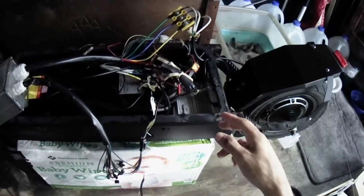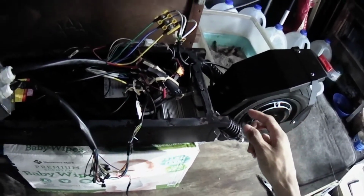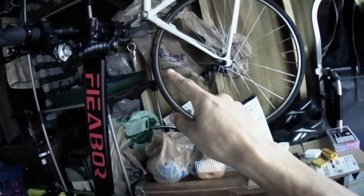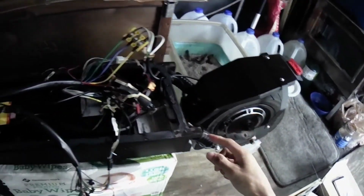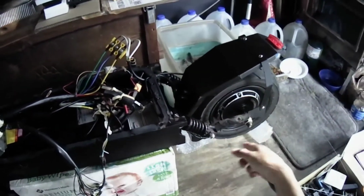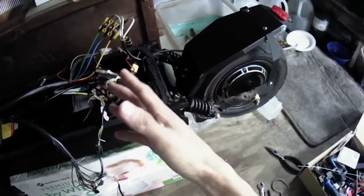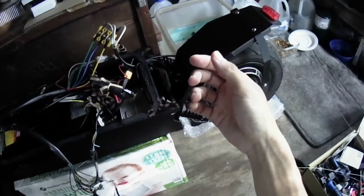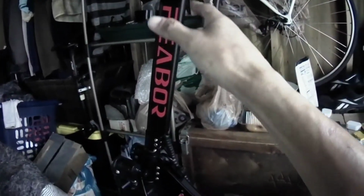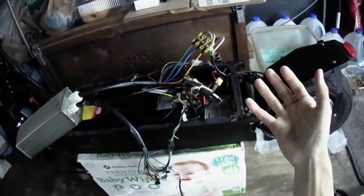They did that on purpose by design for safety reasons. When you ride your scooter and switch to run it in just a single motor, the rear motor will turn, not the front one. That'll give you safer control because the weight tends to shift to the back when you accelerate. So you have good grip and traction, and you have the handlebar to steer left and right. It's a great balance for control.